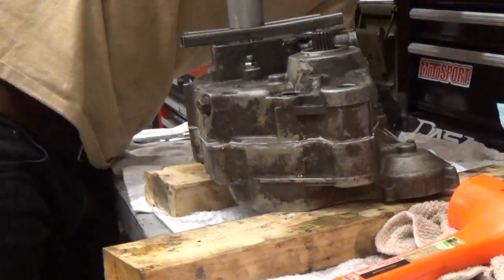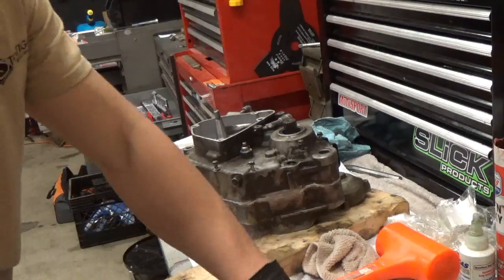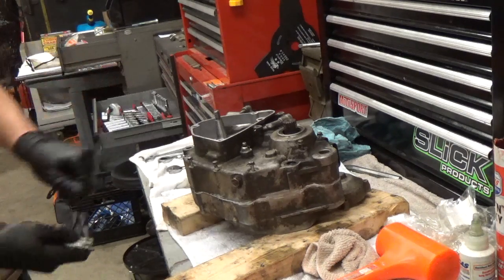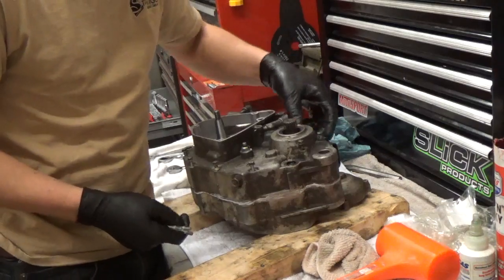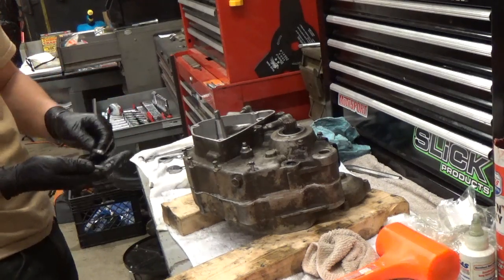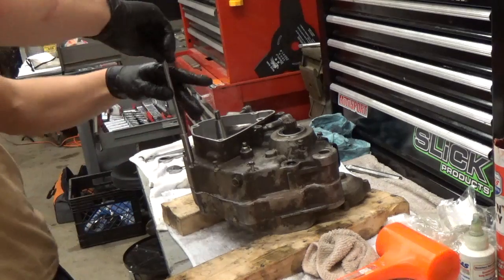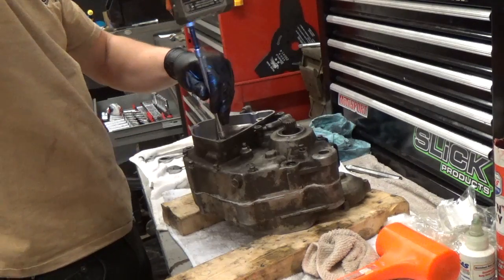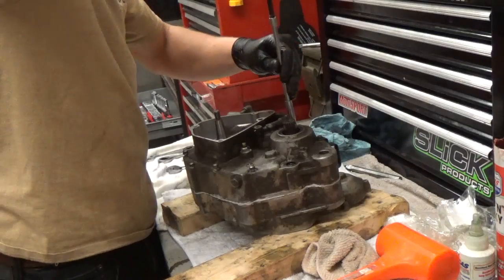I keep cranking down, making sure it's going down even and the gap is closing evenly. You can see as I speed up that the case is completely shut. Next I'll install the bolts for the case. All the bolts should have the same amount sticking up — that's how you can tell if you have the right bolt. If one is sticking up farther, you need a longer or shorter bolt. I like to hand-tighten all the bolts with just an extension and socket first to make sure I'm not going to strip any bolts, then torque them down with my impact gun in a crisscross pattern.